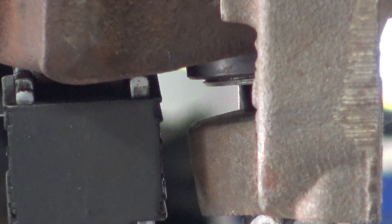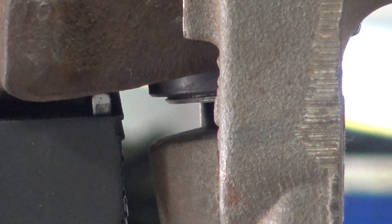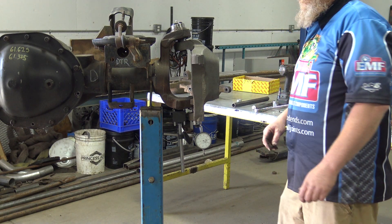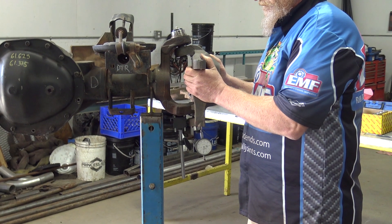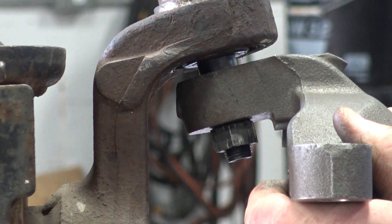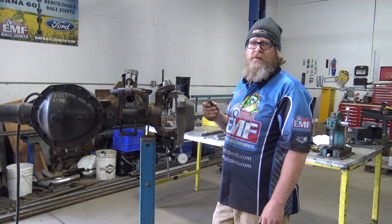There's still a spiral lock in there that would hold the insert in, so the insert would be pounded out and the ball joint would almost be falling out. To get 90 thou of play — for a Dodge dealership to say there's too much vertical play and they're going to call our ball joint when it comes in — it's impossible, it's just a physical impossibility to meet their spec with our ball joint. So when they call it right away, you've got to question it and ask them to show you the play. I'll have guys on my tech line that will tell me that's 200 thou and they will argue and argue, and it's not that I'm arguing there isn't play — it's just that we need to figure out what action we're going to take: whether the insert is pounded out or if it just needs to be adjusted.